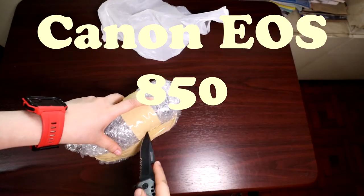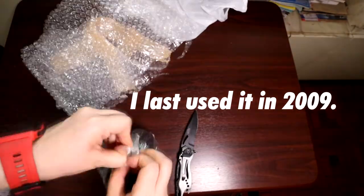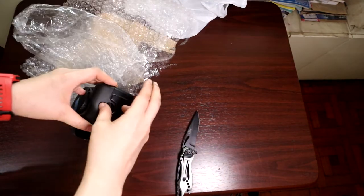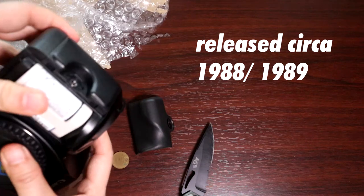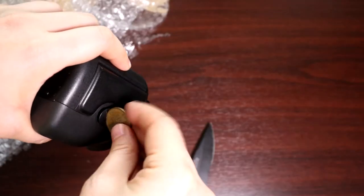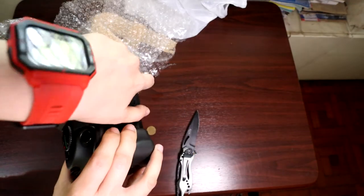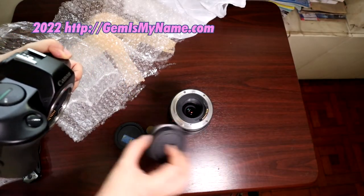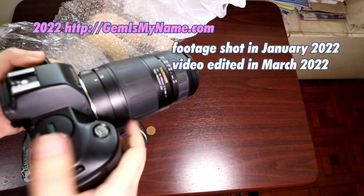This is a Canon EOS 850 film SLR. I last used this in 2009 — I'll link to my album of photos taken with it in the description below. There was something wrong with the shutter mechanism and Dong's Camera Shop repaired that. They also cleaned the slightly hazy mirror a bit. It uses a 2CR5 battery. This is a fully electronic mid-90s era film SLR, so it will not function without a battery. It should be able to read DX-coded film. This is a point-and-shoot version of an SLR in the sense that it has a mirror and allows for interchangeable lenses, but it is a super basic device with no shutter priority or manual modes. It has no aperture priority mode either, but if your lens has an aperture ring, you can use that. It uses modern EF lenses that can electronically communicate with the camera.